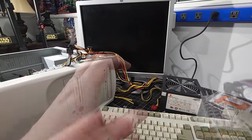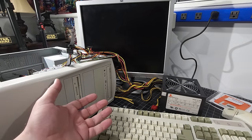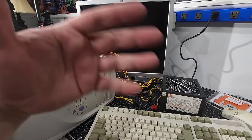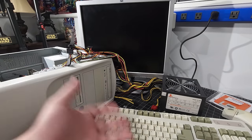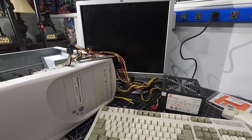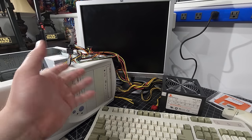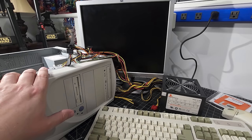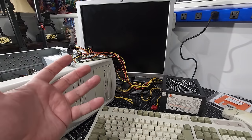And it was so confusing for me. Then I continued to scroll down, and someone had mentioned that it was an issue with the power supply. And we did the test on the power supply. This was a fully working system with another board, another set of components, and everything was working great. So I had no idea what it was. And I went, okay, well, all right, I'll try another power supply. I have a spare brand new one here. Literally, it was out of the box before I started the retro recall. I popped it in and it posted right away. I have no idea what's wrong with that power supply. It's testing just fine, and for some reason, that power supply is not happy with this motherboard. It's a 350 watt power supply, so I wasn't worried about the actual power consumption. But unfortunately, it just wasn't working.